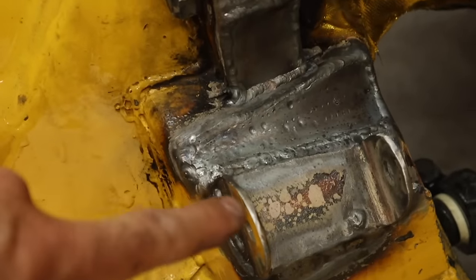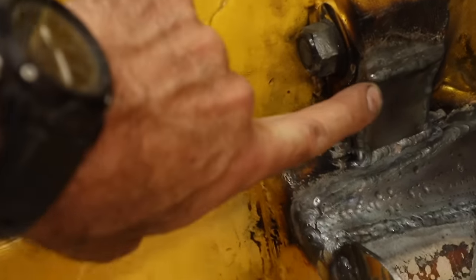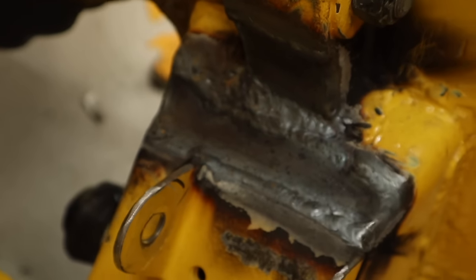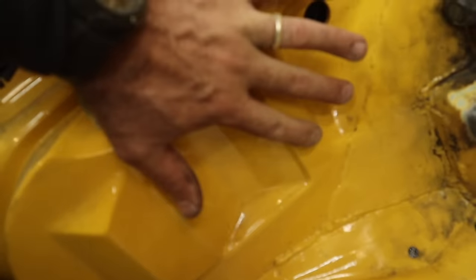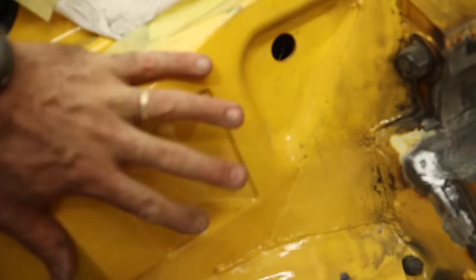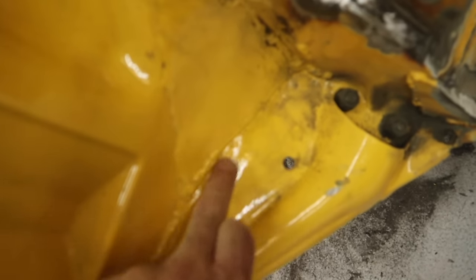It's not pretty, but my engine mounts are in. I've made up all the big heavy-duty 3mm plates, all TIG welded in. I scalloped out the lower edge of this mount because it has a pivot ball mount in there — so this all makes plenty of room now for the headers. Same on the other side, plenty of room. The engine bay is a complete nightmare and I'll hopefully be able to clean it up and make it all nice and neat. The next thing I'm going to do is make a little bit more ventilation down here. All this side is like triple-wall frame rails so there's no easy way to make vents going through there — there are brake lines behind there. Without the bash plate on there should be fair bit of ventilation, but I'm going to add a bit more by opening up these little slots.